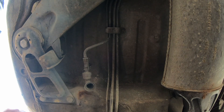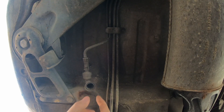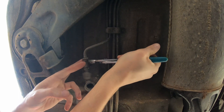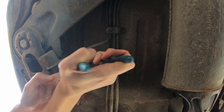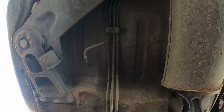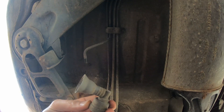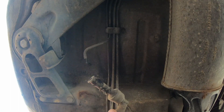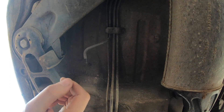Just in front of the left rear tire you'll find this little guy - this is our tank vent valve. We're going to take a pair of pliers, squeeze one of these pinch clamps up here, and pull this valve off. Now, you may not be able to see up in there very clearly, but we have a dirt dauber or mud dauber nest built in the end of this valve, which is going to prevent our tank from venting.